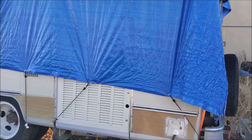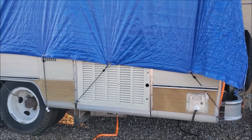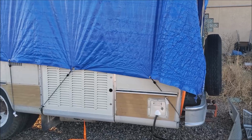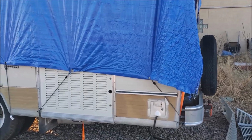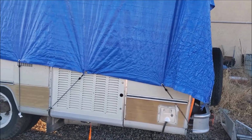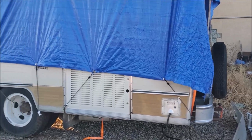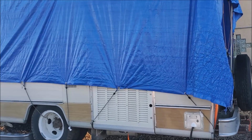Again, that whole varnished gas thing. It's a weird style fuel pump. The short version is that the varnished gas glued that old fuel pump solid. So I let it soak in some brake cleaner and a couple taps from the handle of a screwdriver, I was able to free up the fuel pump, and the thing fired right up, ran, powered both ACs, no problem. The thing was good to go, golden.